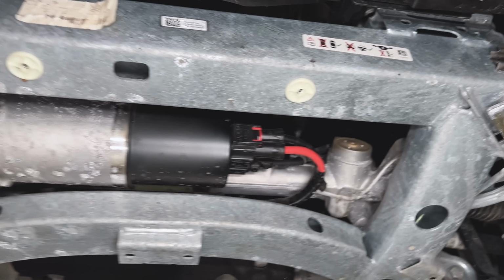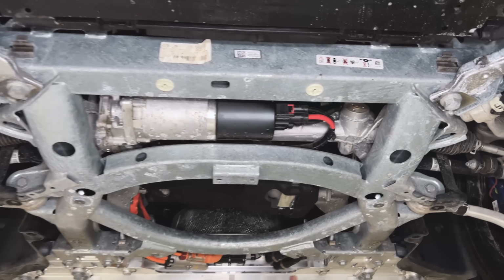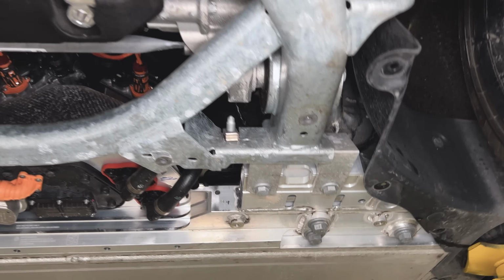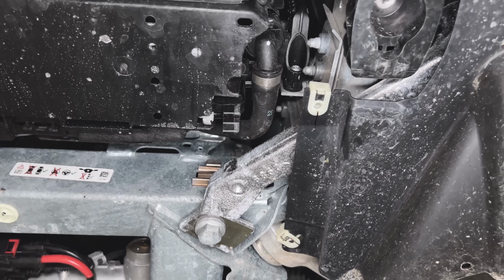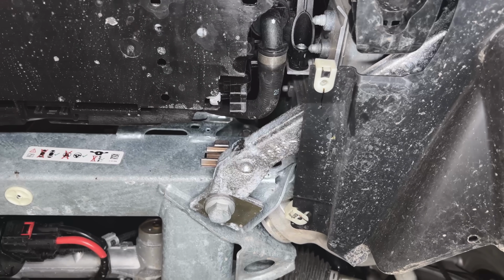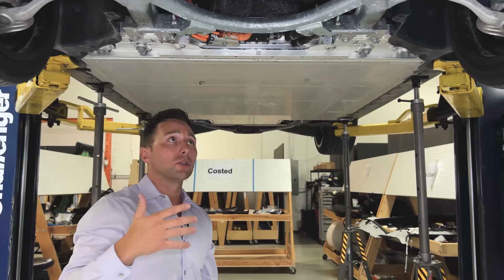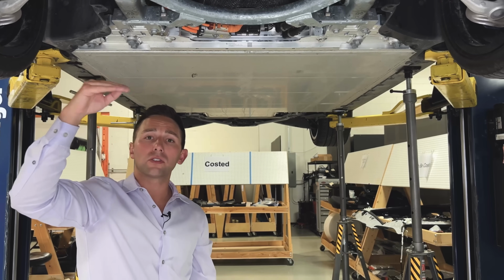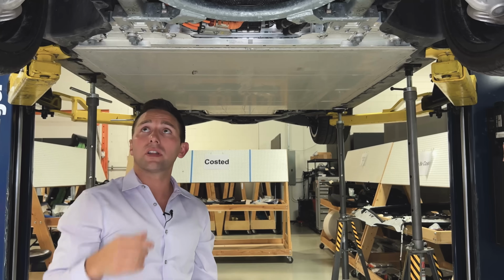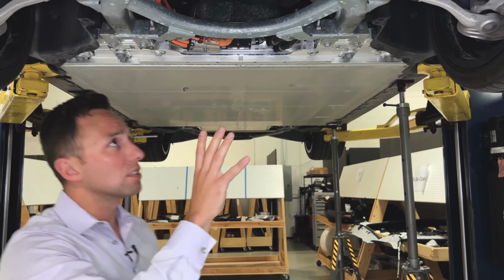In looking at all the things that this subframe or cradle interfaces to, they're primarily aluminum. We've got aluminum extrusions at the tail end, and cast aluminum SORB countermeasures in the front. So in all four corners, essentially, it's interfacing with aluminum. If I had to make a bet, I would say they probably went with galvanized just to help mitigate some of the dissimilar metal corrosion issues. So you don't have to shim between the aluminum components or have an insulator between the aluminum and the steel. That would enable some corrosion mitigation there. So that's the suspension architecture.